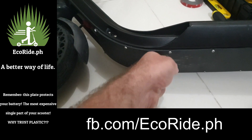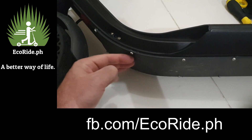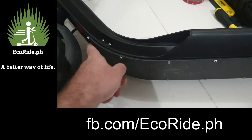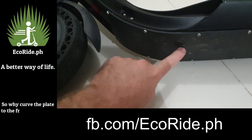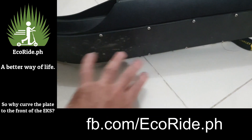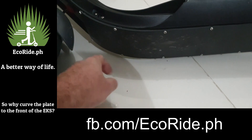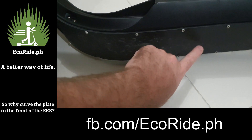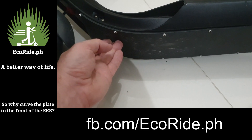Also, instead of stopping the undercarriage with a rough edge that came straight down — where rocks as they come along would bump into it and hit it — we made it curved here. As you can kind of see here, where the rocks hit they don't scrape along the bottom, typically causing damage all the way down the line. I haven't washed this by the way — this is exactly as I turned it over from riding it yesterday. They hit here and they typically deflect down, they go away from the scooter, so the chance of them damaging the bottom has become minimized because now there's no edge for them to catch and nothing for them to grab on to.